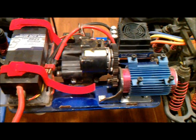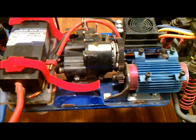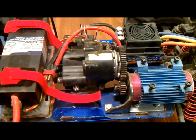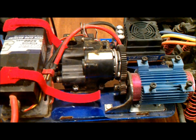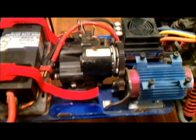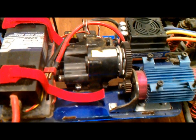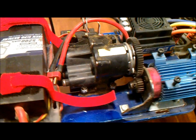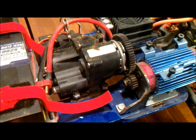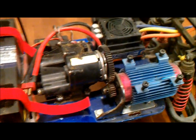A lot of people ask about the transmission. The transmission is still stock. You can get kits — I bought the kit to make it a single speed, which took out the whole clutch part of it. And then I also got the kit to take out reverse. After you put both those kits in, it widens up the gears quite a bit, so it's a little stiffer and stronger. I kind of think it helps so it doesn't strip the gears out, because that's quite a bit of torque from that motor. Now it's just a direct drive.